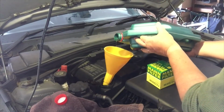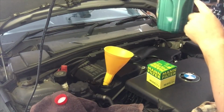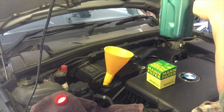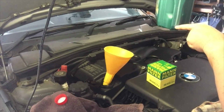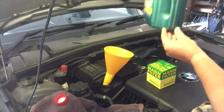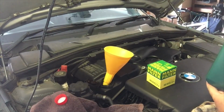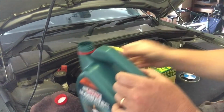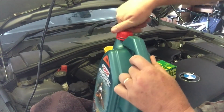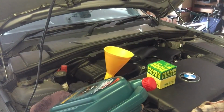Go from there. Now that's going to be getting close. The oil should have down here a marker from the top. It'll be up here to start with, and down here it'll be 1 litre, 2 litres, 3 litres, 4 litres, 4.5 litres, and that's about where we're at the moment, about 4.5 litres. We'll let that drain in, and then we'll give the engine a start and get it level, of course, when you're wanting to get it going.